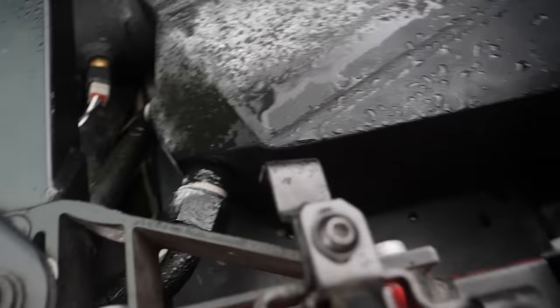Here we can see when I'm starting up the car — we have 37 degrees Celsius intake air temperature, which is quite hot. Then idling and going to the drag strip it drops. During the burnout we have nine degrees, and after the burnout it gets a bit colder at 4.7 degrees — probably as the car rolls and gets more air to the condensers. At the start of the pass we have 4.5 degrees, it goes down a little more to 3.1, and then at the end of the pass in fifth gear at 183 km/h we have 15 degrees maximum. Then it gets cold again. So maximum 15 degrees Celsius on the inlet air temperature — the water itself is even cooler.